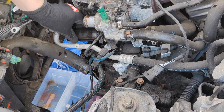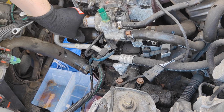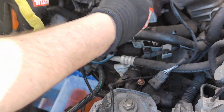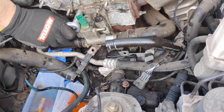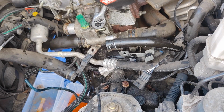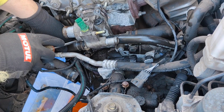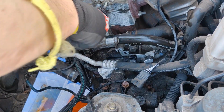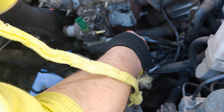At this moment I just squeeze the other hose and the rest of the coolant comes out. Then I start removing the upper one, then the one below that one. Then I started removing three 12mm bolts from the thermostat so it came loose, and it gives a little bit more tension on the hoses that I'm trying to remove right now. Those biggest hoses are very hard to remove. There's absolutely no space and they are very tight.